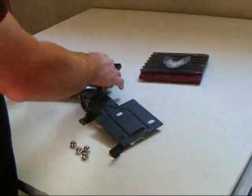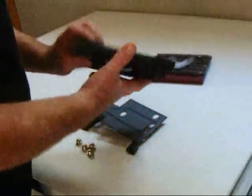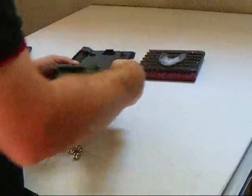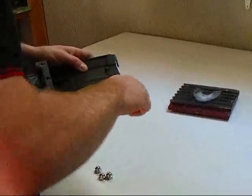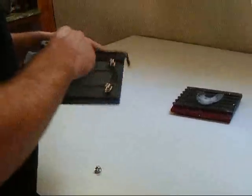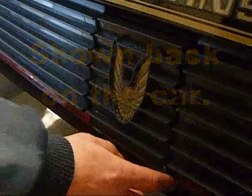These graphics are for GM factory fuel doors — they don't quite fit the new replacement fuel doors, though those are also available. You turn the unit over, set it in place, and the spin nuts tighten down. They sit right in and replace your rusted-out GM ones — the GM acorn nuts had a tendency to rot out.